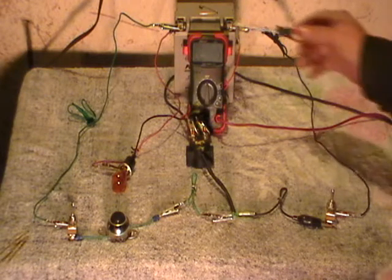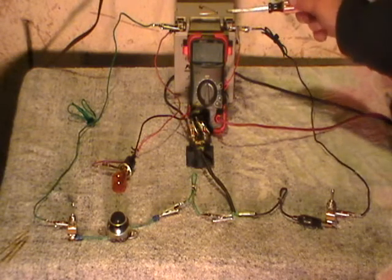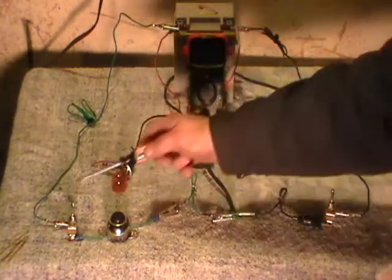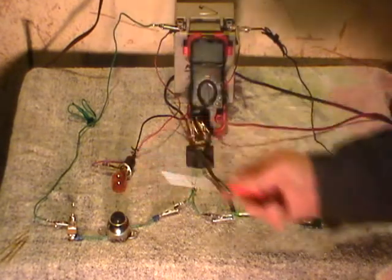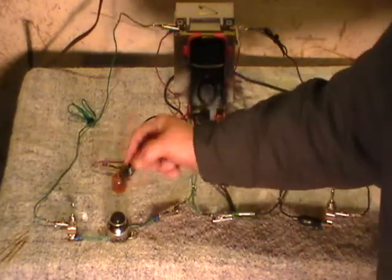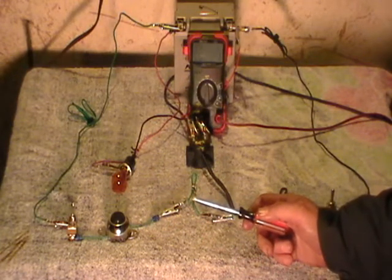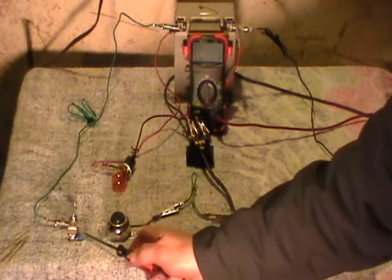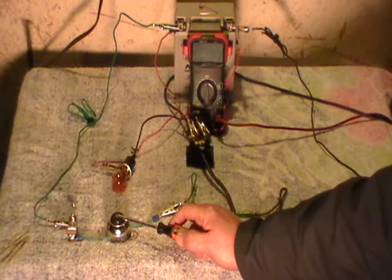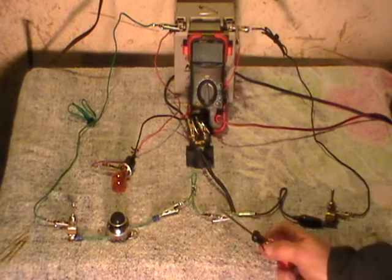Hidden behind my multimeter is the power source — our battery. We have our ground side, our power side, our positive side. We have connecting leads going through two switches. The first switch is going to be our clutch switch. If you look underneath the perch of your clutch, you'll see a small switch with a wire coming in and a wire going out. It's a safety switch — you have to have the clutch in to start the bike. From there, the path goes to a push button switch on the right side cluster, which you push to actually engage the starter.